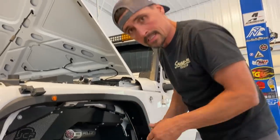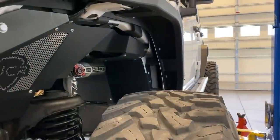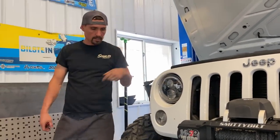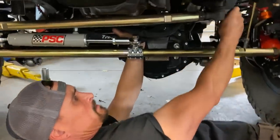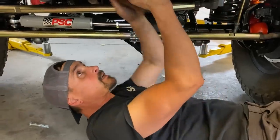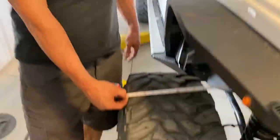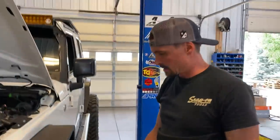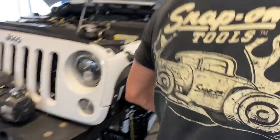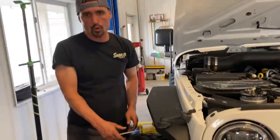We also have to do the upper ball joints, but let's get her centered first. Seventeen and a half to this lug from inside here — these are just ballparks. Seventeen and a half on this side — real close, maybe a quarter-inch off. So let's put it in. We can take a little bit out of the track bar. Third measurement: eighteen and some change — this needs to be like eighteen and an eighth. Spot on! Even Steven — so now we just tighten it all up.